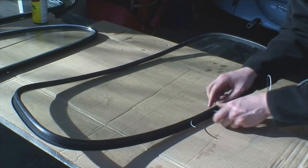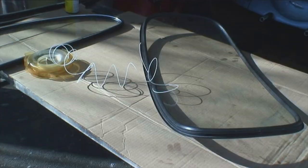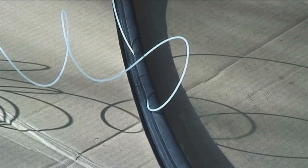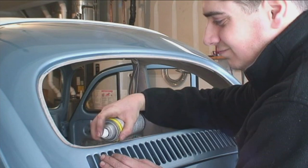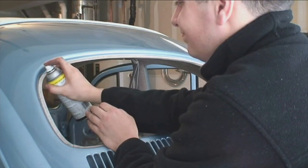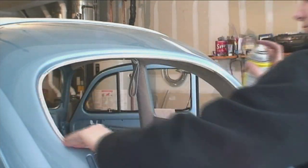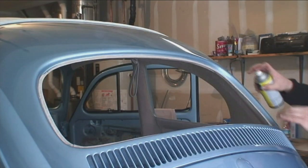Basically I start just rolling the line into the seal. You're going to put that into the inner flap — this is the flap that goes inside the car and is going to wrap around the lip opening where the window goes. Crisscross them at the bottom. I do this as a precaution because sometimes the seal just does not want to go into the window opening right away. So I use some silicone or soap on the corners for lubrication so the rubber will slide in and line up better. If it's too dry, sometimes you're fighting it — just use some silicone on the corners where they usually hang up.